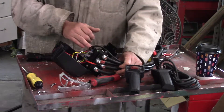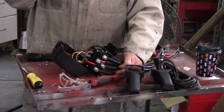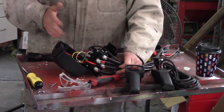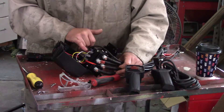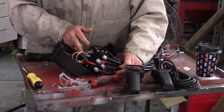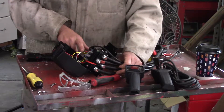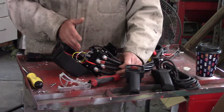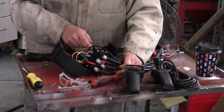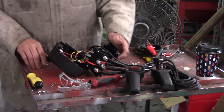The whole top of this thing has now been sealed with glue, so I'm assuming water was intruding into it. Maybe their manufacturer said it's water resistant, not waterproof — they sold it as waterproof and it ain't waterproof. Interestingly, the wires on here have a cloth insulation, which you see is common in aircraft. I have a feeling that may have been what the problem was — the water was wicking into these and getting into the board somehow.